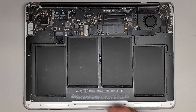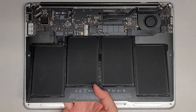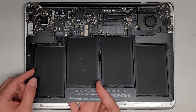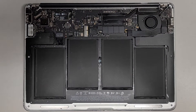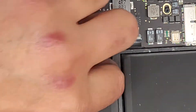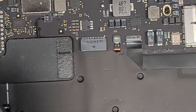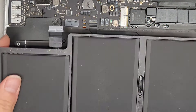Once you've removed all the screws for the battery, get underneath here — I find it works easier to get underneath from this side. You lift it up, get your hand underneath. You don't want to just pull it backwards; you prop it up like that with your fingers, then grab this cable here and wiggle it. You want to prop the battery up slightly because the lip of the battery can get caught and I've seen people tear this cable, so be very careful with that.